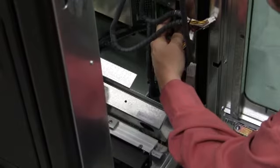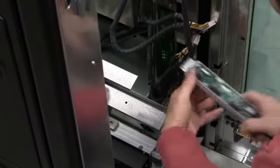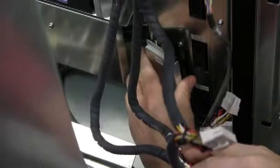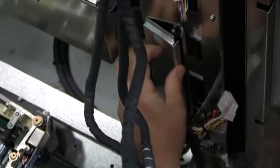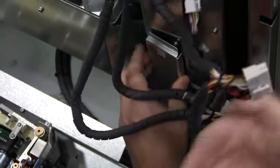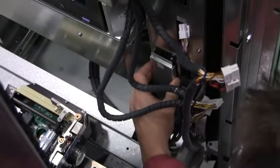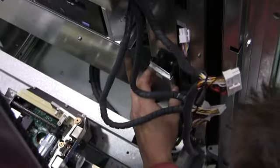These are very brittle and they can bend, so when we put the power supply controller in, we need to make sure that we've lined it up properly before actually pushing down. The easiest way to do that is to get it at the side and get one row of pins in and then kind of tilt it, rotate it toward you. This will go ahead and slide the remaining pins in.